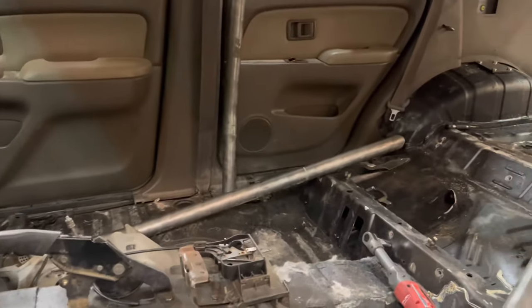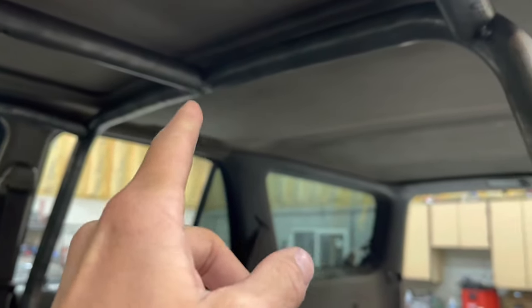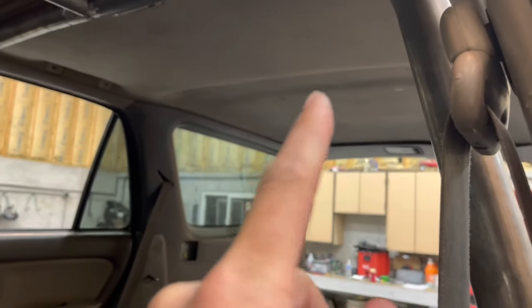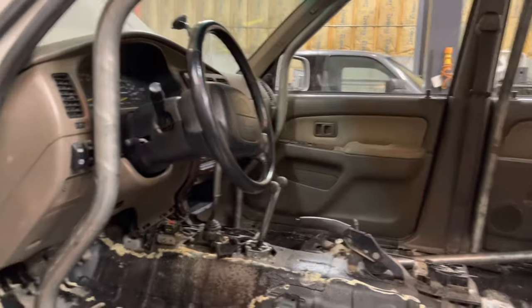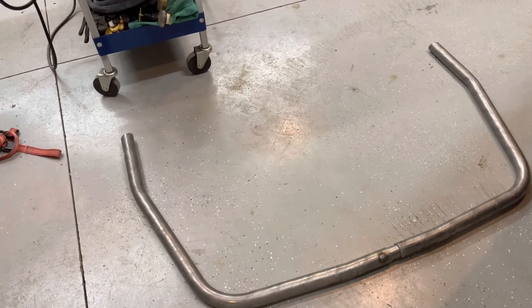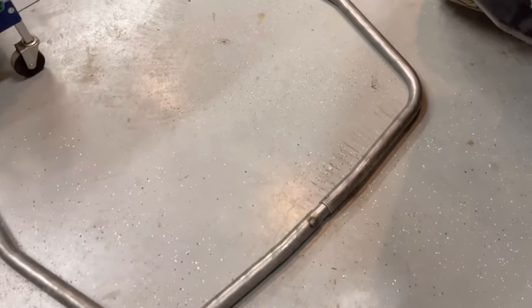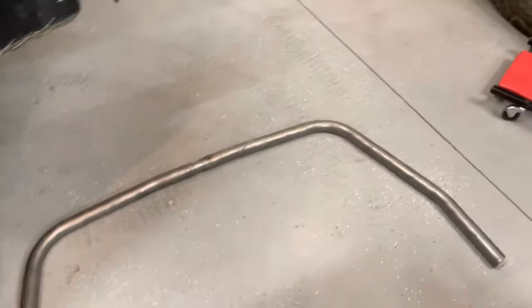After everything's tacked in I'm not sure what to do, so I want to get the main structure figured out first, work out how to weld everything in, and then worry about the tubes. There's a center tube going from B pillar to C pillar and some cross bracing in the D pillar area. That's where we're at today — I'm going to get this welded up, get it in place, and maybe use a tie-down to hold it together and tack it.